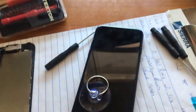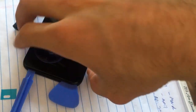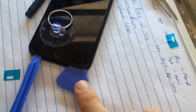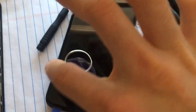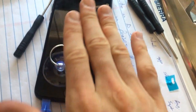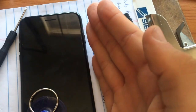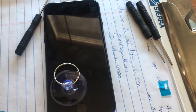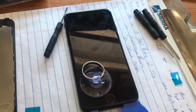Taking off iPhone 7 screens is definitely easier said than done — this is taking me about 10 minutes. Be very careful, patient, and delicate with all this stuff. I found that using a suction cup at the bottom, lifting up, and then prying very carefully was the best way to sneak in a guitar pick. Now I have a little plastic spudger to help pry up on this, and we're very carefully working our way around the sides. Do not just lift this screen up or you will tear out all the ribbon cables.